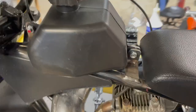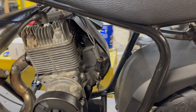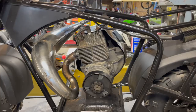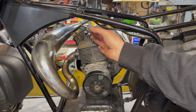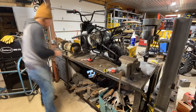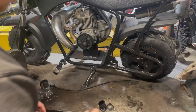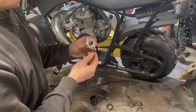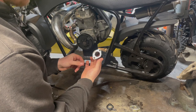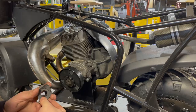As you can see I got the gas tank brackets done and this thing's fitted in there really nice. Now we just got to get a fuel shutoff mounted to the frame for our fuel line, and then get this intake situated and get that carburetor in there. I'm going to get a tab cut out and weld it onto the frame so we can control the on/off to our carburetor. I just got done building this little intake elbow — I took the factory aluminum intake, cut the horn off, traced it onto a piece of steel, cut it out, drilled it, and then I just took a little round pipe and welded it around. That's just going to go right on there, using this little piece of hose as a coupler.